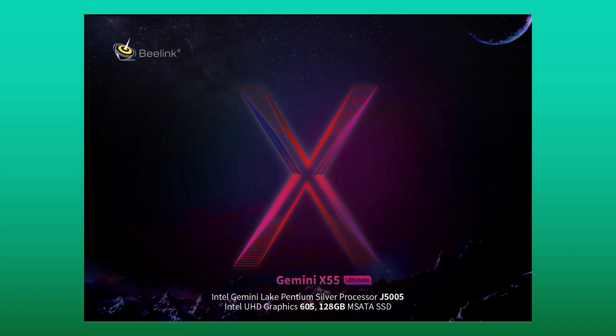Now most of these are quad core, but some of them go under the Celeron brand, and those are lower clocked and have a slightly less good graphics performance. The Pentium Silver, as we've got in this particular machine here, has a higher performing graphics section, has more execution units, and it's clocked higher. The base clock on this is 1.5 gigahertz, as opposed to, I think it's 1 in some of the slightly cheaper chips, and also the laptop variants, which are also clocked lower.